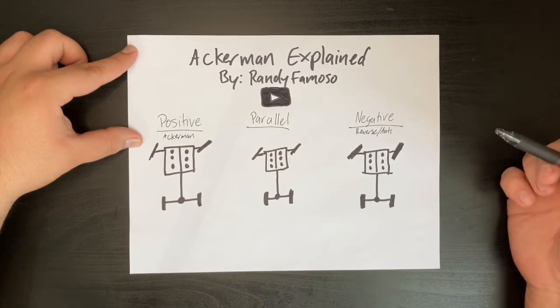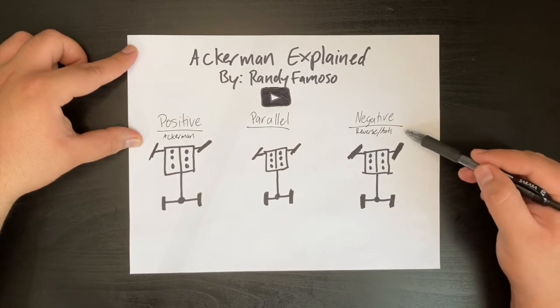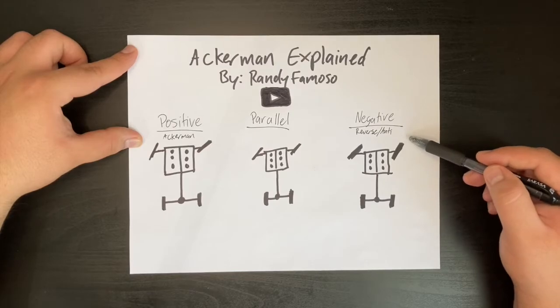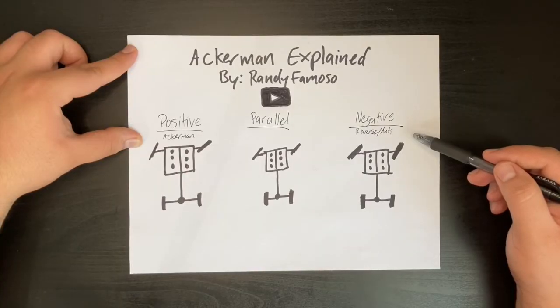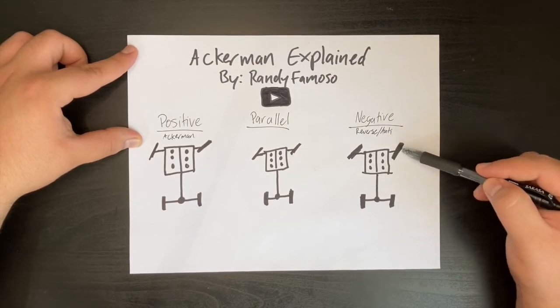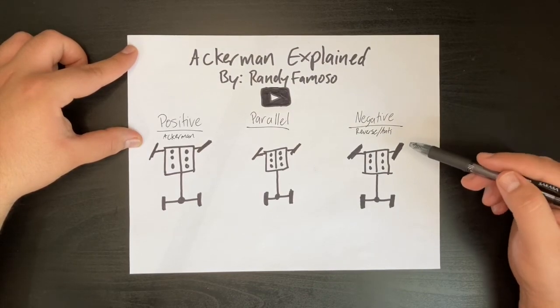All I wanted to do with this video is give a quick overview of what it is so you can understand it and dig deeper if the topic interests you. While we're talking about negative Ackerman, I wanted to mention that since E36 and E46 chassis are so cheap and so great for drifting, a lot of people get them and want to keep their budget low, so they buy these eBay angle kits. These angle kits are like $20 to $30 USD, which is a bargain for some angle, but the problem is that they have negative Ackerman, which makes it so your trailing wheel has more angle than the leading wheel, and this often results in the wheels locking in place when drifting. So you should really think twice about purchasing that.